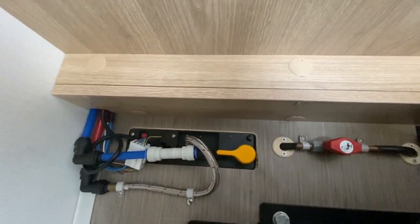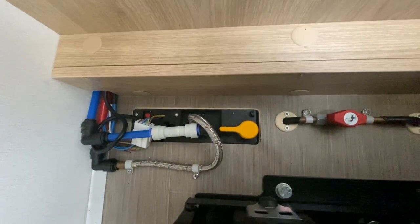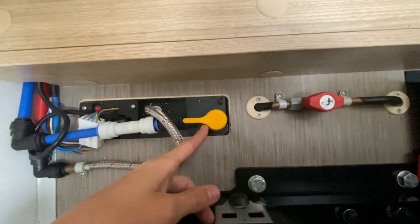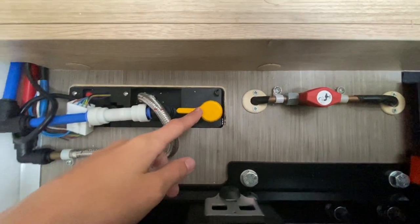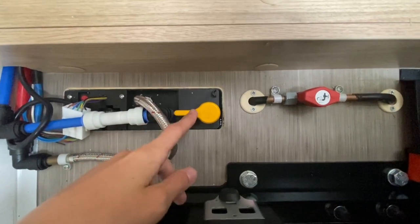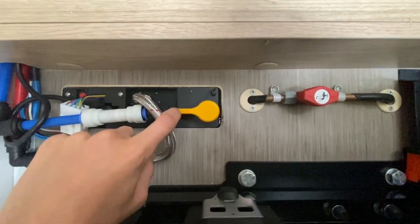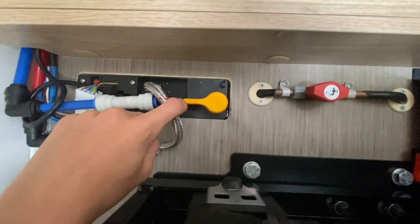Underneath your driver's side bunk — just behind the driver's seat — if you lift the bunk up you'll find your winterise tap. This is a very important tap. In winter, when the van is not in use or standing between trips, you want to drain the water. Don't leave any water standing in the vehicle when frost is about as it can freeze the water in the water heater, and this wouldn't be covered by warranty.